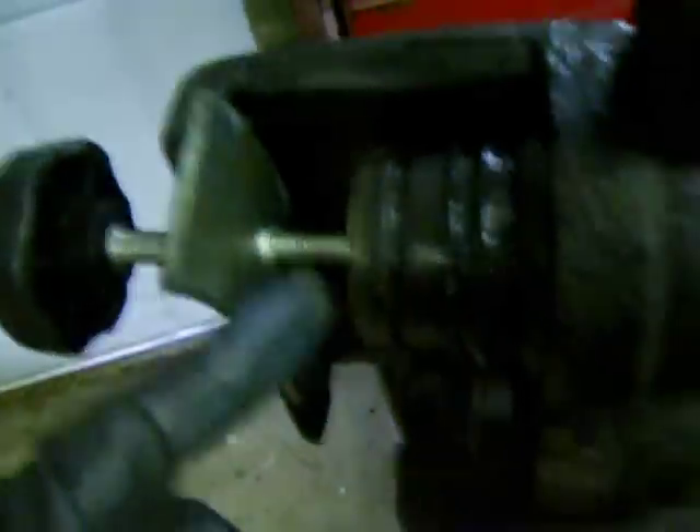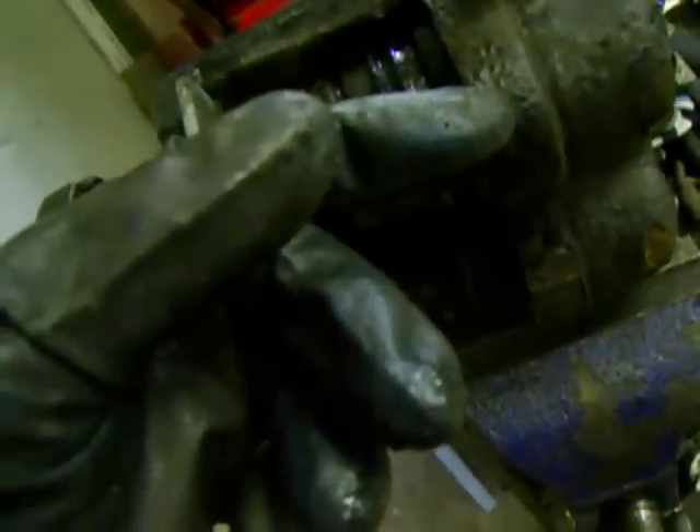So now I'm faced with putting the piston back in. What I did was I pulled the piston out, and once you pull it out, in the bore you can see there's a seal. It's sort of like an O-ring — well, it is an O-ring, or a square ring. It's in the shape of a cross-section of a square, but it's circular and fits in a bore right inside there. And I took that out because obviously that's what I did not want to cook.